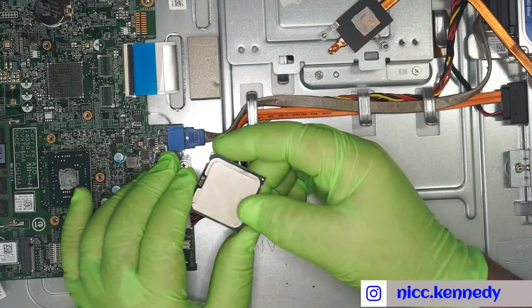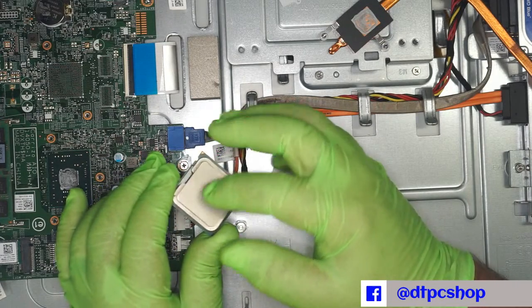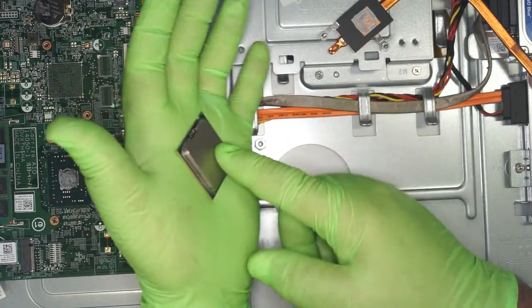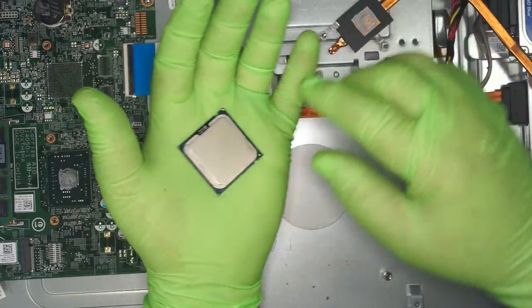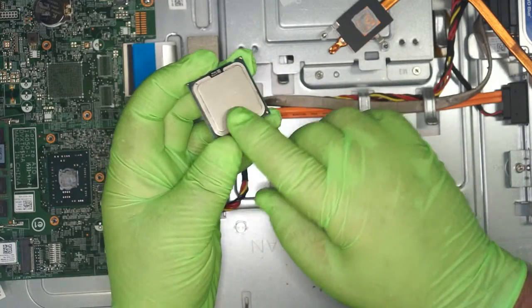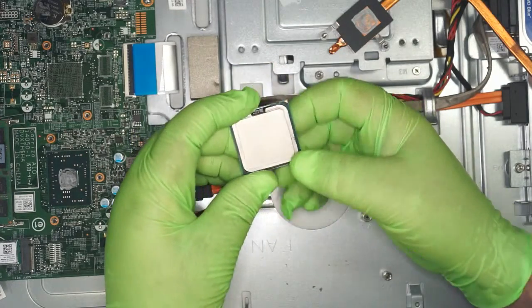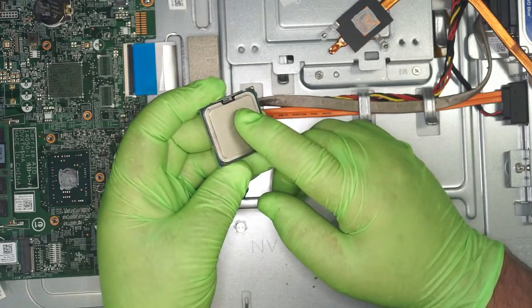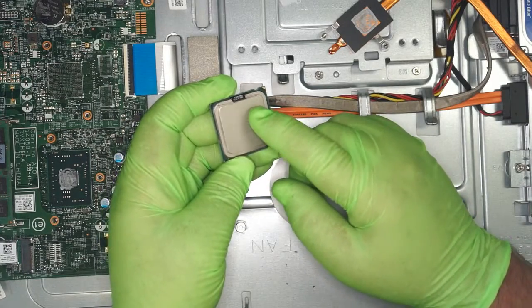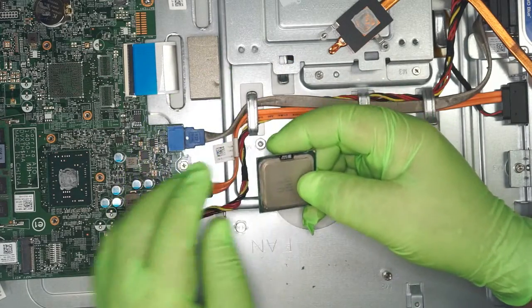You can lap these, which is basically sanding off the nickel and silver, whatever the coating is on. I think it's nickel and a couple other things. Plus the surface is very inconsistent. It's not flat, even though it appears flat. Once you start sanding it on something flat, it'll come off unevenly. So they sand it down with finer and finer grit sandpaper until it's all copper. All the copper is revealed, and then they get it to a nice mirror polish.